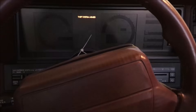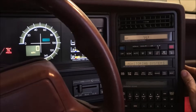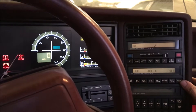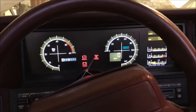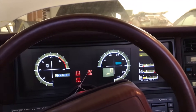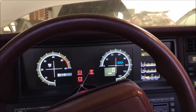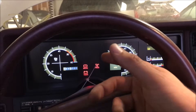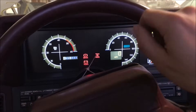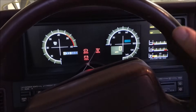I know it's a good starter I just put in. It's the only thing I'm wondering — with that theft system armed. I know I hooked up the starter right. I know it's a good starter; I've bench tested it before. Unless — I was rushing down there because of my spider phobia. And I used my electric ratchet to tighten up the little wire and the stud. Like it started spinning just a little bit. Maybe I broke something.